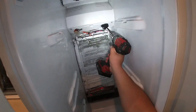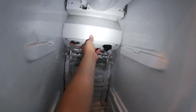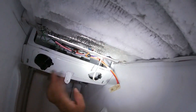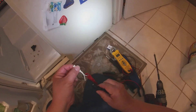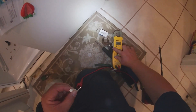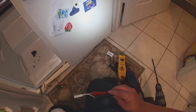This is an indication that our heater and the defrost thermostat are fine. However, we're going to go ahead and replace the defrost thermostat and the thermistor because the homeowner wants us to replace them for preventative maintenance. I didn't have the heat element with me in this case, but sometimes I like to replace everything — the thermistor, the defrost thermostat, and the heat element — as preventative maintenance. However, this repair went a little different because it ended up being more than these three parts.